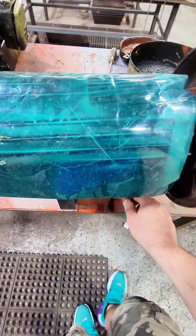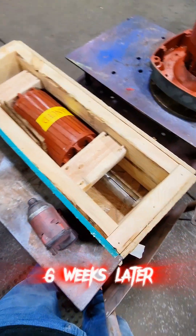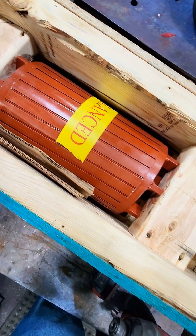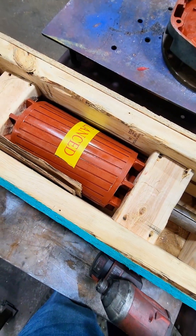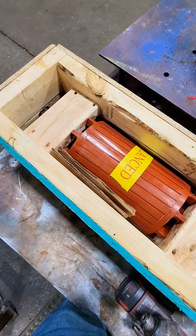We can use a trick and stick this rotor onto a growler, which is going to induce current into those rotor bars. You can see that gap right in the middle, right where that damaged bar was — that means we have broken rotor bars. So we had to send this rotor out to be completely rebuilt, which took about six weeks. When I opened the box, I was really surprised to see that it was balanced, because that's just one less thing that we have to do.